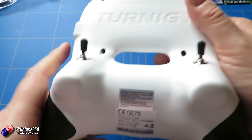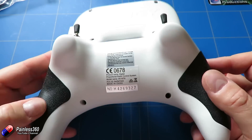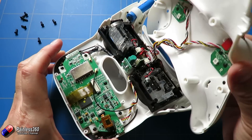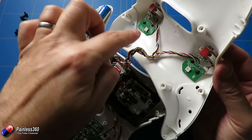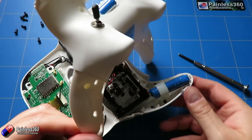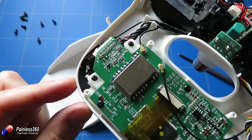We also took this apart to see how the antennas were routed — though I wouldn't recommend doing this yourself, as there are no user-serviceable parts inside. There are six visible screws plus two under some plastic pieces that peel off and are tricky to reattach. Inside you can see the antennas are routed into the very top corner of the shell, and the LEDs are on the back part of the shell shining through the clear gimbals. The inside looks pretty well made with additional room, and the rechargeable batteries are visible at the bottom — those are charged via the USB cable.